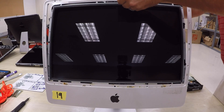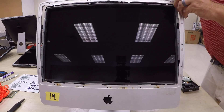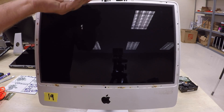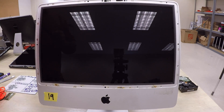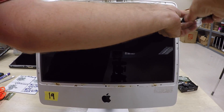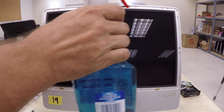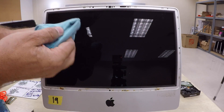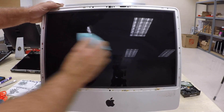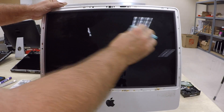When putting in the faceplate, go from the bottom and cut the tape with scissors so you can reattach the microphone cable at the top. Screw in the faceplate screws — the large screws go in the bottom four holes and all other screws are the small ones you removed earlier. Take a microfiber cloth and gently wipe the LCD panel, then blow it off with the computer cleaner to remove any dust.